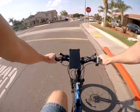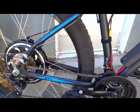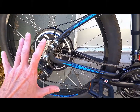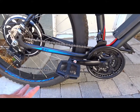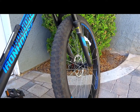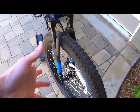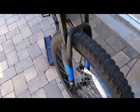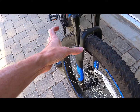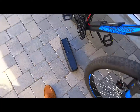I like the look of the bigger tires, but the key thing is you get real suspension from the rubber itself — the tire hitting bumps gives you compliance. This is a rigid rear with no rear shocks, which I actually like because the fat tire soaks up a lot on its own. On a cheap bike, suspension in the tire beats paying for a cheap suspension unit. The front fork is surprisingly good and it couples nicely with the tire compliance for a smooth ride.